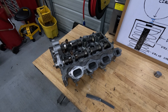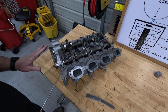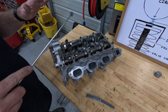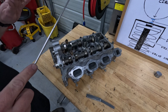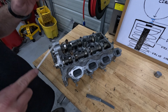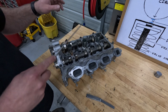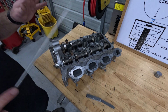Now, to determine what your measurement is going to be for your valve clearance, you're going to reinstall the cams, and you reinstall them with the lobe up. When you bolt everything down, you're going to have three opportunities to take your measurements. Every time you bolt it down you'll take a measurement, unbolt it, rotate the cams, bolt it back down, take your measurements — and you do this three times per head.